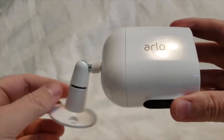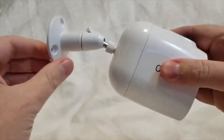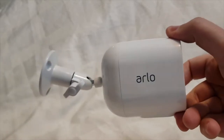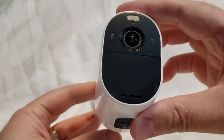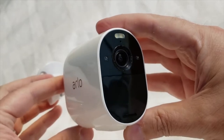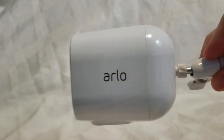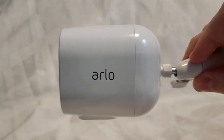The Arlo app provides instructions for setup, and for me this was fairly straightforward except for one snag: I had to turn off my phone's auto-connect to my home Wi-Fi network, because as long as that was enabled the camera wouldn't connect. Once I turned that off, it connected right away — and ever since then it's been smooth sailing. You also need to make an Arlo account, but that took about a minute.